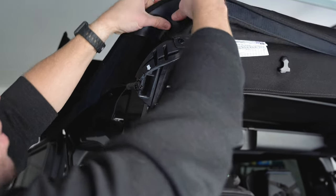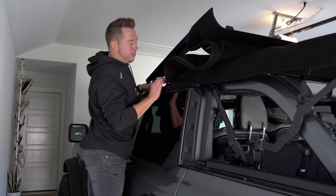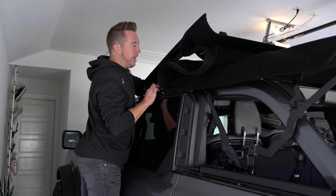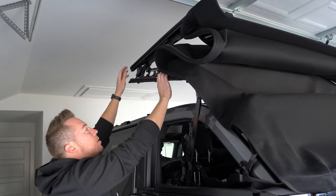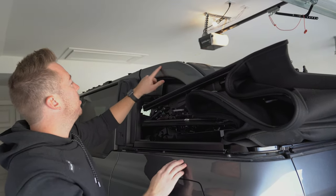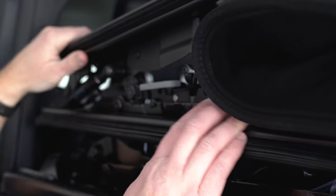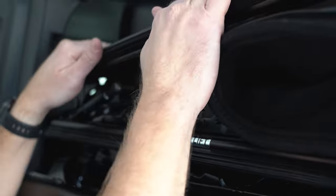Once you've taken that back panel off, remember to fold these back if you had flipped them up. Now we're going to fold the top all the way back. There's actually a button right here — a little gray lever that says 'press' — and next to it there's a sticker that says 'lift', which is nice. You're going to press that down until it releases the latch on both sides. Now as you're folding this back be really careful not to let the hardware scratch your paint. Once you have this folded back it'll set right here, but you need it to latch — it's that same latch — and you're going to push down and it will latch.